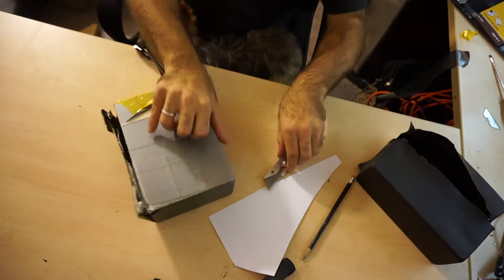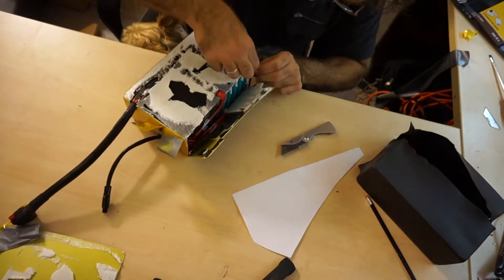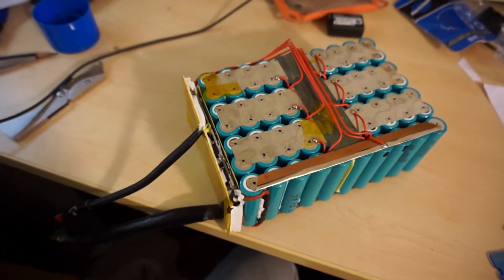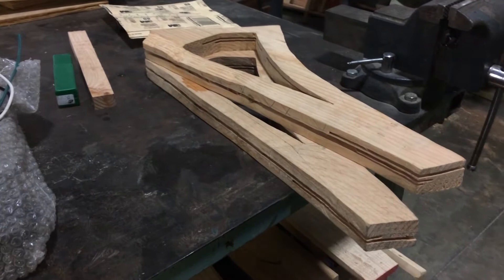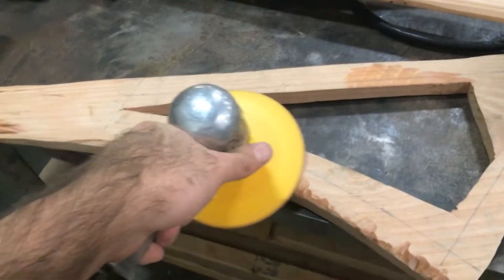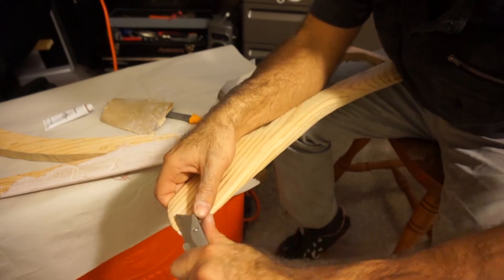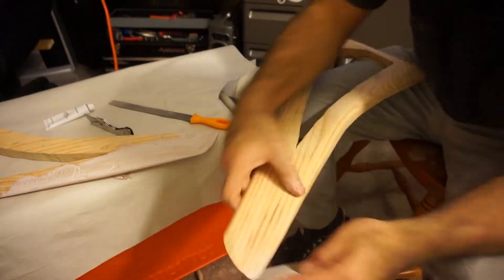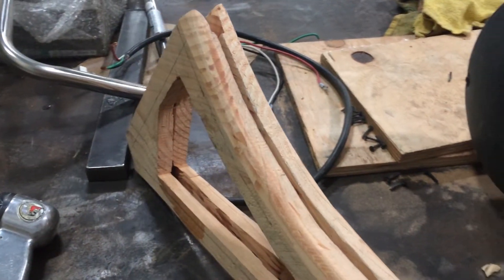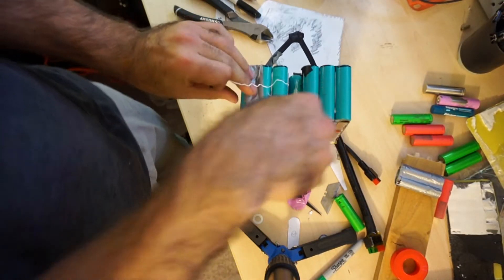When the battery finally arrived I cut open the casing and had to re-solder it. The batteries actually looked pretty clean. The battery I chose was the 50-volt 9.5-amp-hour lithium-ion — I chose lithium-ion so it would be smaller, but lithium-ion batteries are much more complicated to work with. The battery had 50 cells in it, in banks of five running in series. I had to cut apart the batteries so I could move one bank to another part of the triangle, so the battery pack would no longer be square — it would be a triangle.